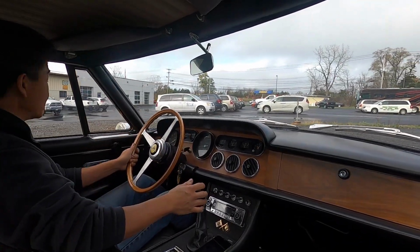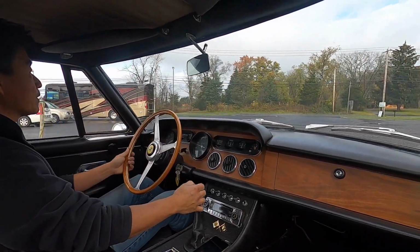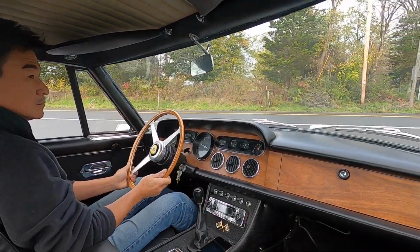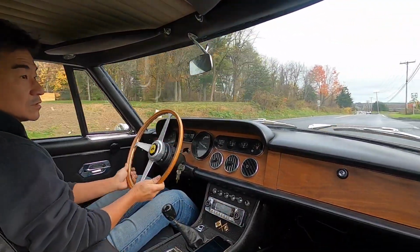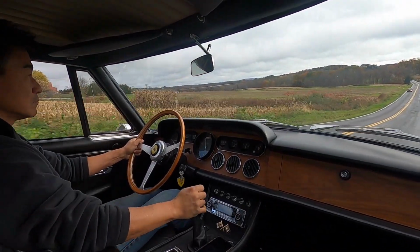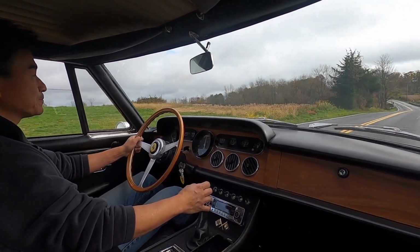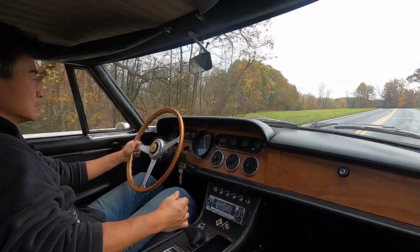I hear a little bit of a brake squeak coming back, but that also just might be because the car's been sitting around for a while. See how the revs don't come down? So let's just take it back here. A little damp out this morning, so not gonna really get on it. Carburetor's a little snappy. Might need to richen them up a little bit more. Yeah, definitely.